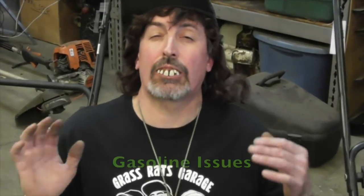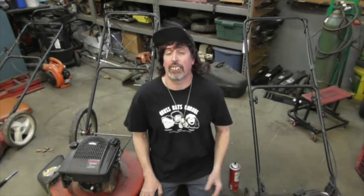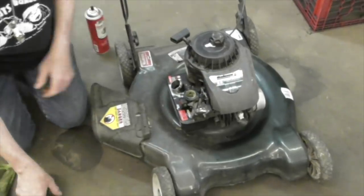Okay, now we're going to address the fuel, because Uncle Andy couldn't get his started. We live in a part of the country where our lawnmowers sit. You may live where you use your lawnmower year round, but we live where they sit for months at a time. The gas gets old because the gas isn't that good these days. It goes bad fast. So you're going to want to get the old gas out of the gas tank. You got to drain it out somehow.